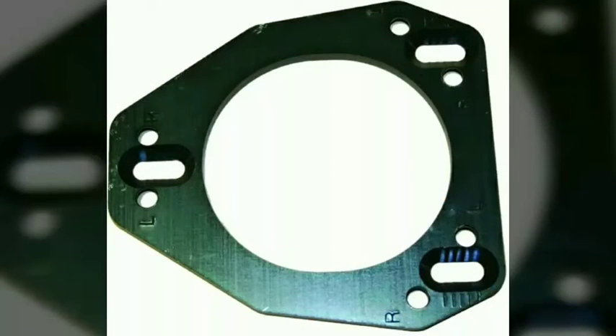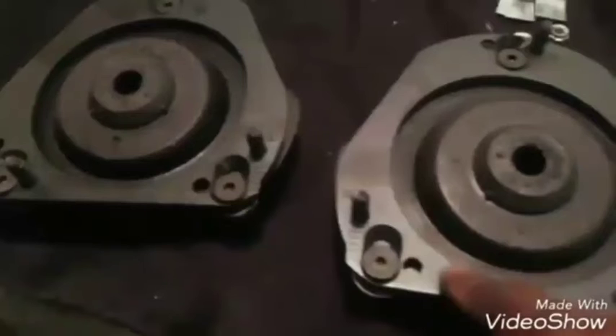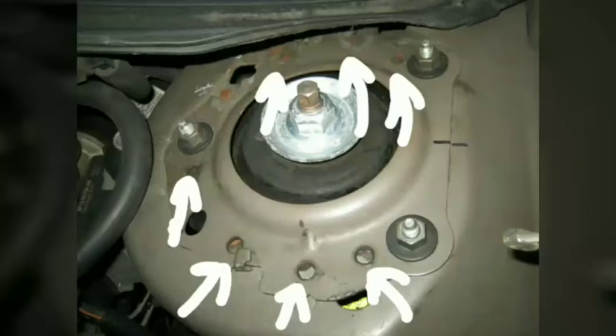Now on a 96-2007 Taurus, it's not adjustable when it comes to the camber in the front, so you're going to have to use a camber kit. In this case, the plate right here. You remove the studs from your strut tower mounts and bolt this in. This basically requires you hammering out the original studs out of the shock tower mounts. Here's a picture of it already installed. I'll leave a link in the description showing how I did it. You also have to drill out the spot welds on the mounting plates, marked with arrows. Once you drill those out, you'll be able to do all the adjustments you need to get the camber in check.